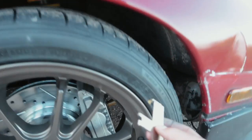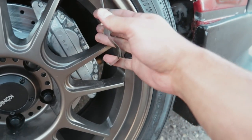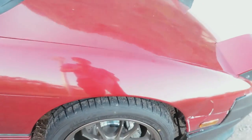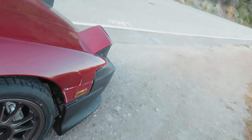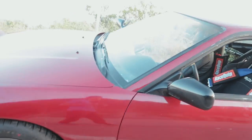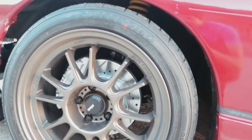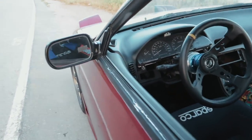We were driving and on the right side there's a shim or spring retainer — I don't know the official word for it — but it keeps popping out and bouncing around, so it was making a squeaking noise. I just pulled it out; I'm not sure how necessary it is. Other than that, the brakes are much better than the stock calipers. They bite instantly, way harder, and they're not fading at least not yet. It's not that pricey of an upgrade, so I definitely recommend it.